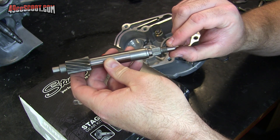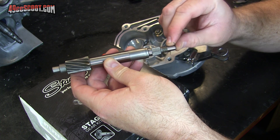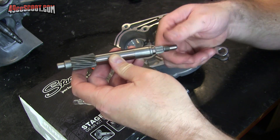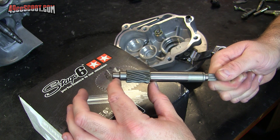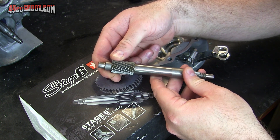That bearing in the CVT cover — I won't say useless, but it could use a lot of work. I don't really like those a lot. So having these two really firms it up quite a bit and takes some of that play out, and it has seemed to lead to less gearbox trouble when I've been running those setups.